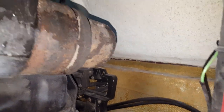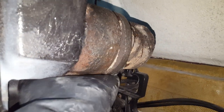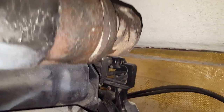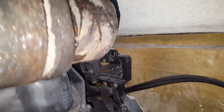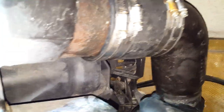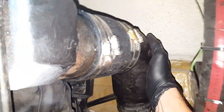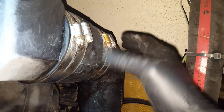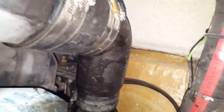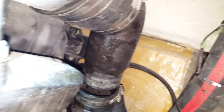Let's go ahead and install the top piece. I'm going to coat up here a little bit with some soap, and coat inside the fitting as well. Let's see if we can slide this in here. Take a look — all of our worm clamps are accessible; try to plan that out the best you can. Notice it bottoms out all the way against this flange. If this rubber doesn't bottom out against the flange, you installed the rubber coupling backwards.